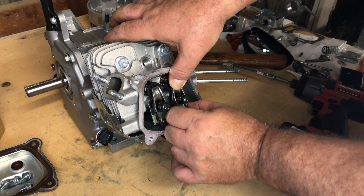Same head — 27mm intake, 25mm exhaust. The combustion chambers are around 20cc or so. Looking down the ports with better light, this one isn't as bad as the other one was — it's probably close to the 224 Predator ports, which is a lot better than the first head. The head bolts have some patches of rust, likely from that white acidic sealer. They'll clean up, and if not I might use brand new head bolts from a care package Cane Custom Garage sent me.